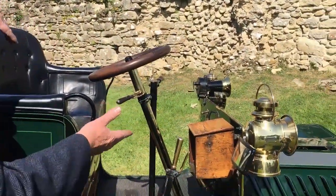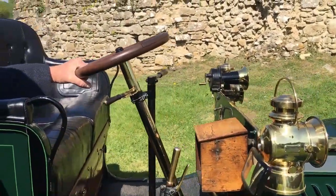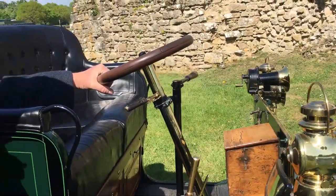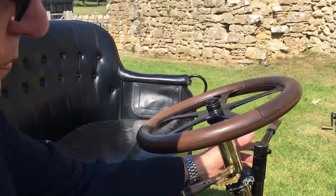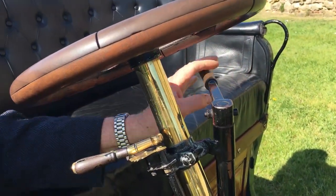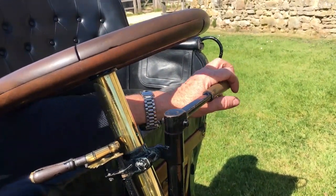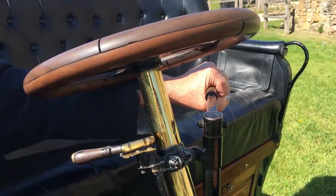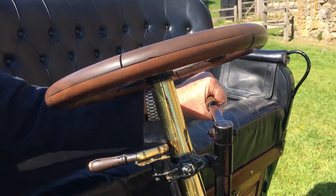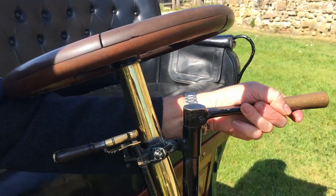It seems complicated in a strange sort of way, and it can be very complicated to drive and even more complicated to stop. On the steering column, this is your gear control. You pull this back for first gear and push it forward for second or top gear. The clutch mechanism uses an epicyclic gearbox, so when you ease the lever back you're contracting a band around a drum which picks up the drive, and the further you ease back the tighter you clamp around the rotating drum until it's locked solid into gear. This is also your clutch. When you're up to a reasonable speed you push the lever through neutral and then into second.